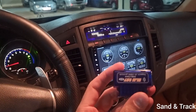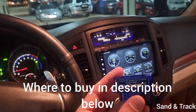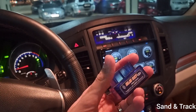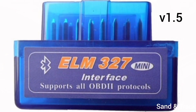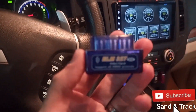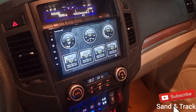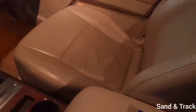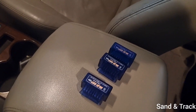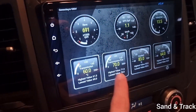To get started you first need one of these — it's an OBD plug. This is one of the typical ELM 327 plugs, OBD 2 port plugs. They go straight into the car and read the different parameters from the engine ECU. You need a specific version if you want to read the transmission temperatures on the Pajero. Not all of these work. I actually bought three different versions from different sellers until I found the right one that can actually read transmission temperatures on the Pajero.